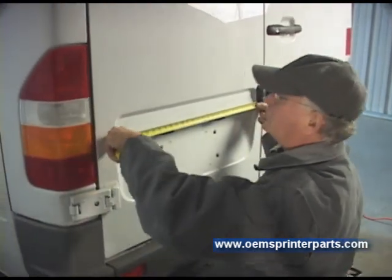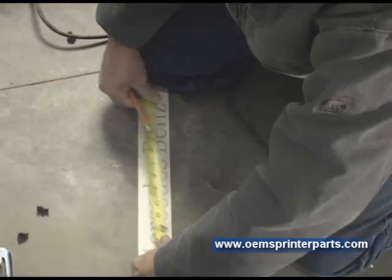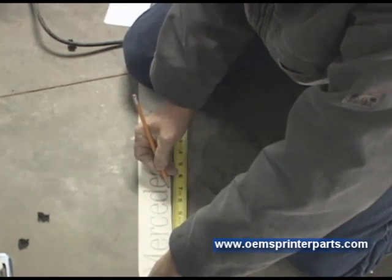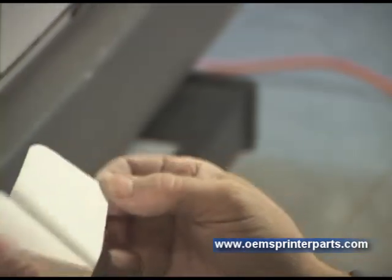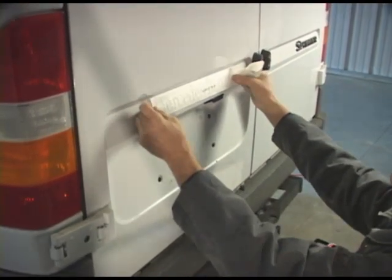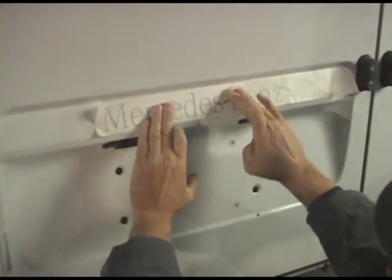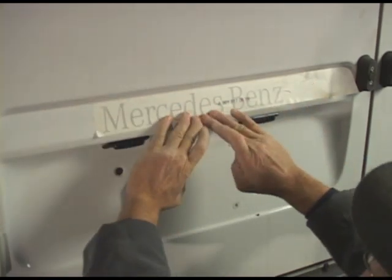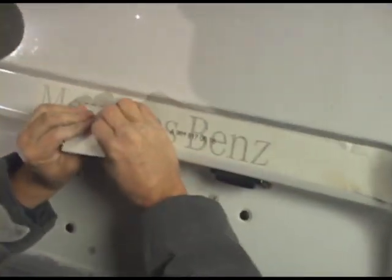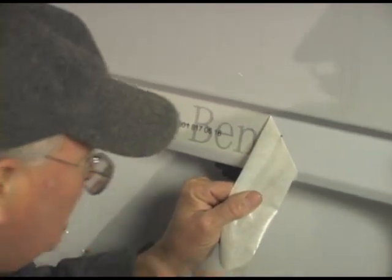Find and mark the center of the door panel with a pencil or crayon. Find and mark the center on the front of the rear door decal using a pencil. Slowly remove the protective backing from the decal. Be sure none of the letters pull free from the facing. Holding the decal by the application tape or pre-mask, align the decal with your center mark and press into place. Using a squeegee or plastic credit card, go over each letter to ensure proper adhesion. Slowly remove the application tape or pre-mask by gently pulling it back and away from the door.